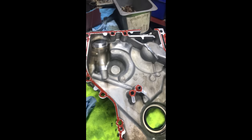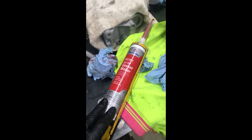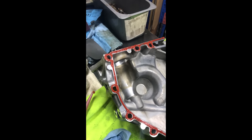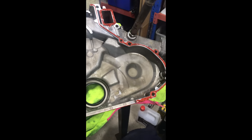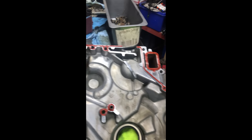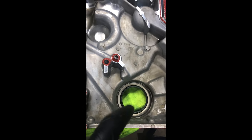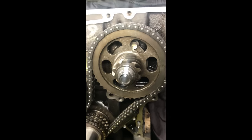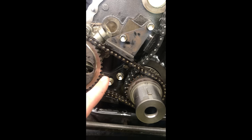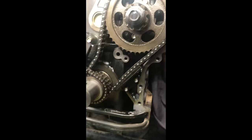Fit up the tensioner, then the oil pump slash fuel pump sprocket and the crank sprocket for that — they don't need any particular alignment, it's just a drive. There's also a top guide which you bolt on with the tensioner, and the other chain tensioner is just a hand tensioner, not oil assisted like the other one. Put a bit of oil on all these surfaces — it's just nicer when it first cranks up before the oil gets to everything, so not to have all this dry. Cam bolt and oil pump bolt torqued to spec. Cam retainers, cam bolt, tensioner bolts, tensioner, oil pump tensioner, oil pump guide, oil pump nut, chain guide — all done. Keys are all in, chains are lined up, shiny tooth aligned. Ready to go.